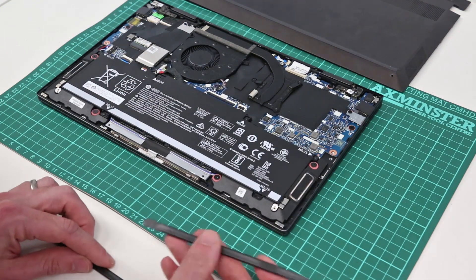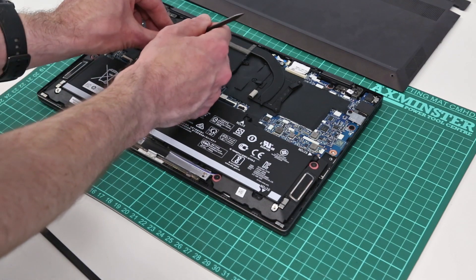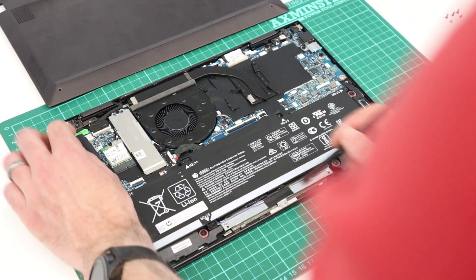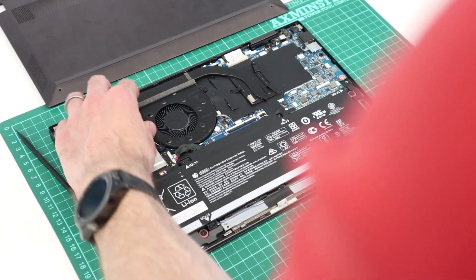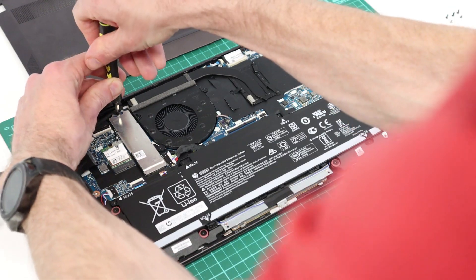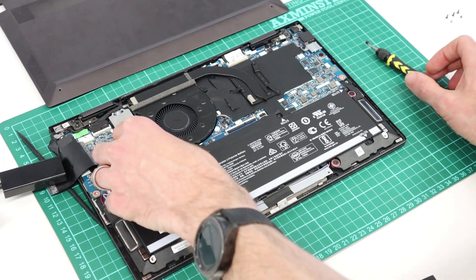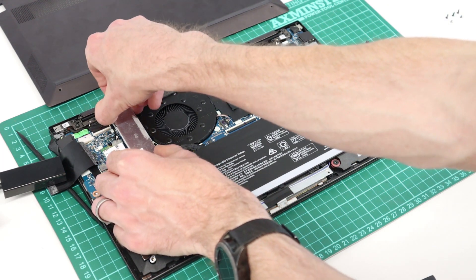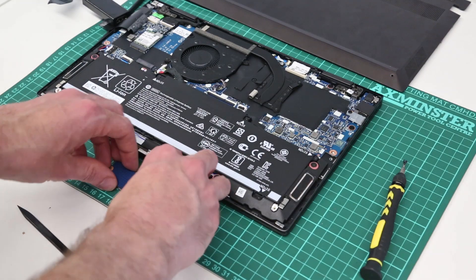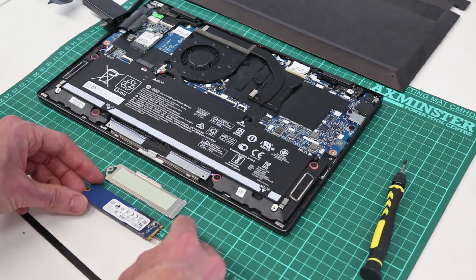Inside we will see that a lot of this is covered with anti-static or plastic coverings. To get to the SSD, we are going to lift this covering here — just gently peel that back and use it to hold it down. To get to the SSD, we then remove the little metal plate that sits over the SSD itself and pull the SSD out. We can then place the SSD onto the work surface and remove it from its carrier.